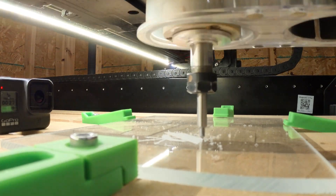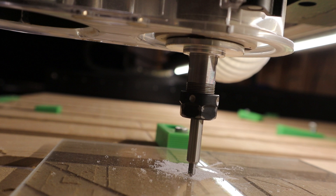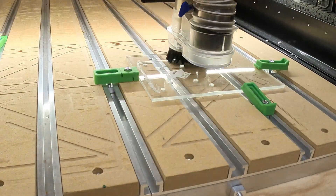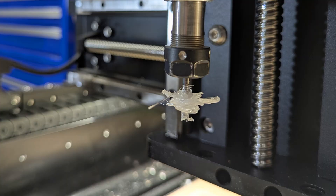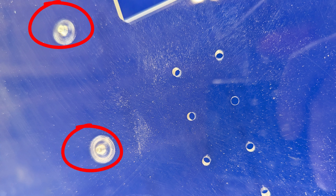It's probably not a good idea to use this for wood, but it works really well for soft metals and plastics. When you're done etching, you switch out the bit to a regular cutter and cut out the holes and the shape of the parts. But it's not all wine and roses — cutting acrylic on a CNC is very tricky. If the material gets hot, you will melt instead of cut and end up with buildup on your bit, which causes more friction and melts the acrylic even more. You could end up with a really big mess. For some reason, a single flute bit seems to cut plastics better. After some trial and error, the piece turned out awesome.